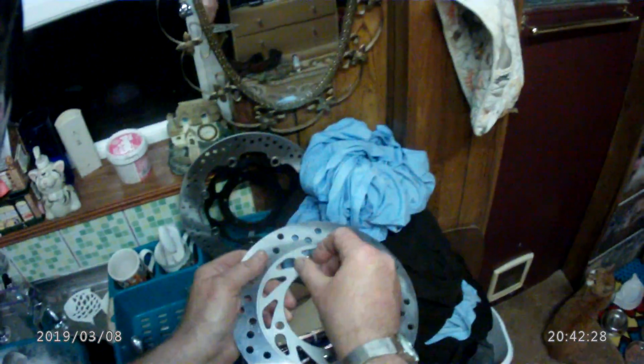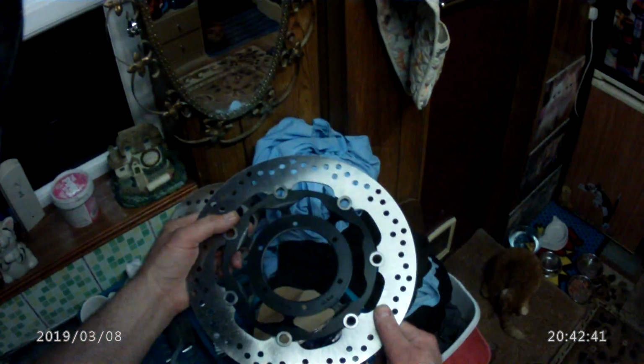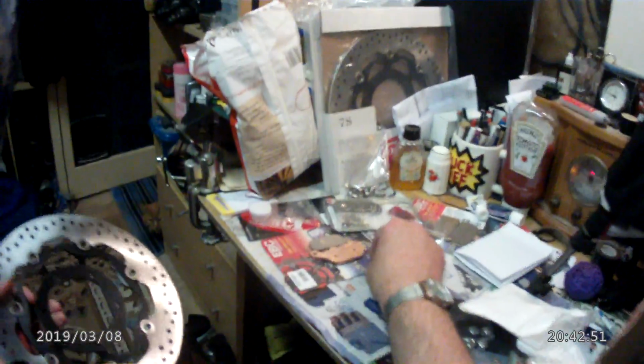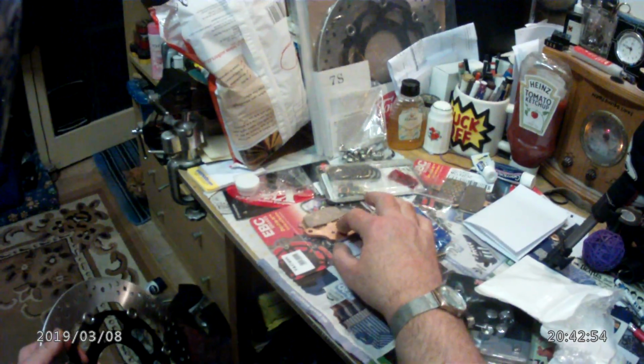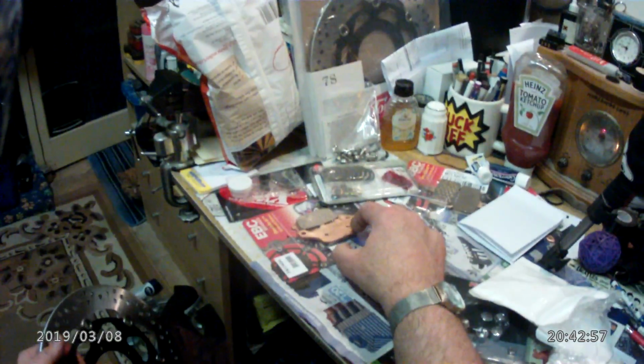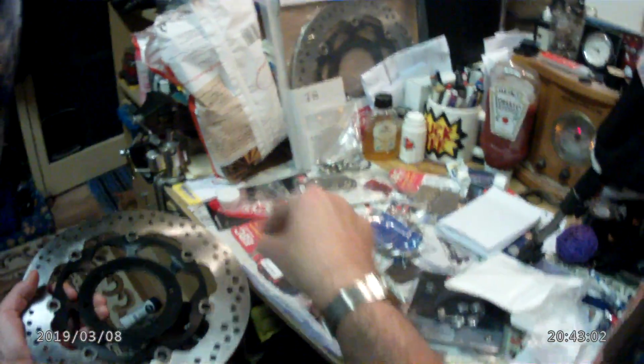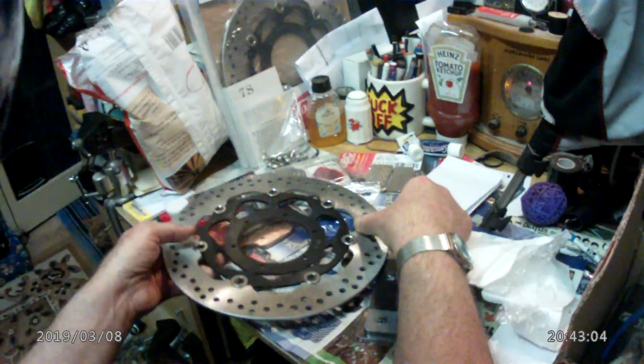I know it won't be a very wise idea to change all the discs round. I'll just do the front, see how it works out, and then when they've bedded in and the pads have bedded in, I will do the rear ones at a later date, unless I do them all at once and see how they go. You can to a certain degree bed rear ones in the backyard: put it on the main stand, get the engine running, put it in gear and just touch the brakes until they bed in, so it's all done instead of faffing about.